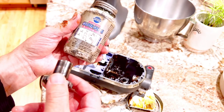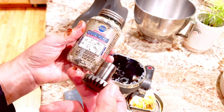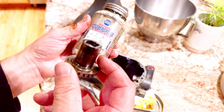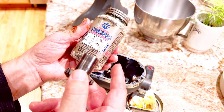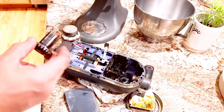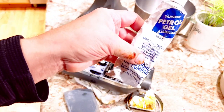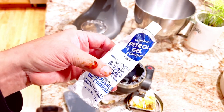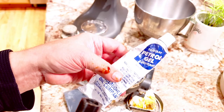Just a tidbit for those doing this repair or who discovered their hub assembly has been seized: you're going to continue to have to do this repair over and over again if you use standard food-grade greases like this, or even moly grease — it just won't hold up under extensive use where things get a little warm.